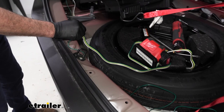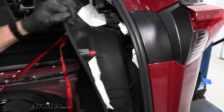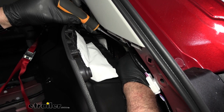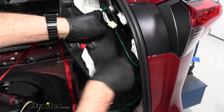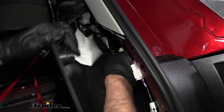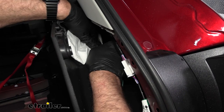Speaking of the passenger side, let's go ahead and show you how we're going to do this. I went under here — we're going to run this along the rail, and then our connections are going to be in the same location on this side. It's going to be this plug right here. I'll still have to use a flathead screwdriver to pop that out. Don't forget to run your wires underneath your plastic and around the backside. Then we'll plug into our connector and plug into the factory connector. These kits are great — there's no splicing, no nothing. These fit the factory connectors nice and tight and you just won't have any problems out of them.